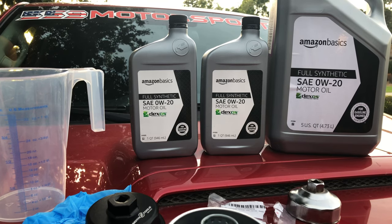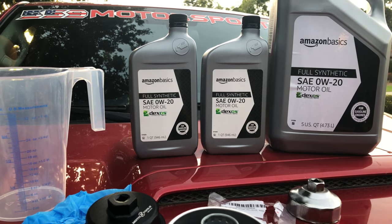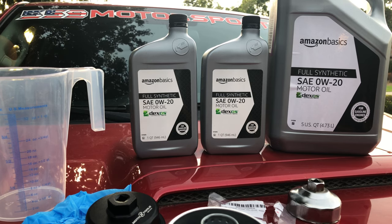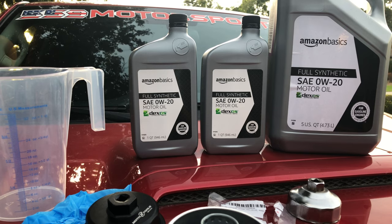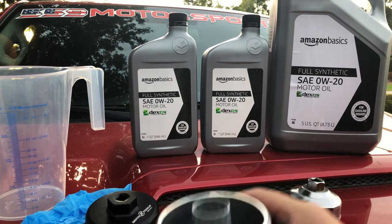Today I'm going to show you how to swap out your oil filter housing on the 4Runner. If you do your own oil, you probably noticed it's a plastic housing, which I guess to some degree probably makes sense somehow, but plastic tends to get really tight when oil gets hot. I've had multiple issues getting mine off, whether that be because it got locked on due to being plastic or Toyota using an impact gun like they're not supposed to.